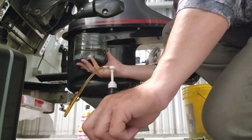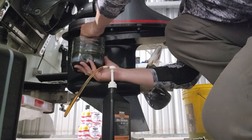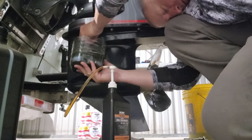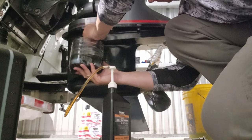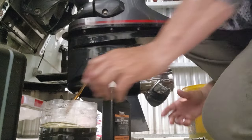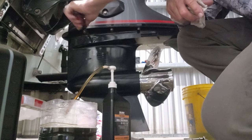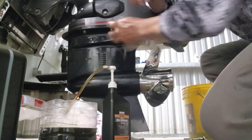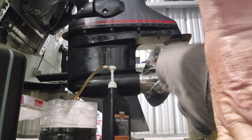So now, I'm going to take the top screw, which is the shorter, fat one, y'all. That's what she said. And I'm going to put it in the top screw hole, the shorter, fatter one. So you're going to put the shorter, fat screw in the top screw hole, y'all. Tighten that down. Remember, we've already changed the O-ring out on it. You just want to hand tighten it. Don't wrench on that thing, because if you do that, next time you go change your oil, you get ready to take them out and all that, it's going to be hard. You're going to end up stripping your screws and all that. So don't wrench on it, y'all. Just hand tighten it a little bit and it's on there.